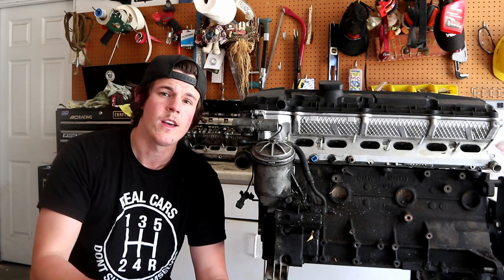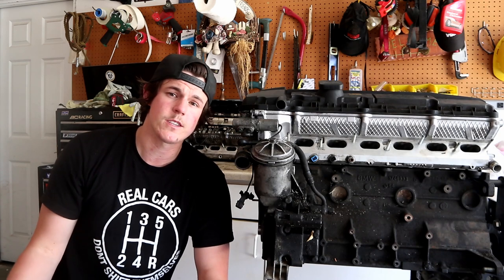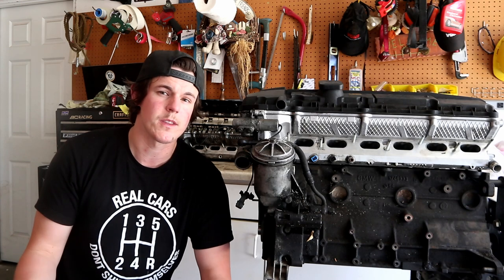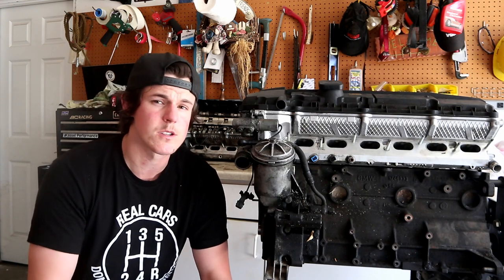So if you're leaking oil and it's either red or it smells like ATF, the transmission uses ATF. Some of them use heavyweight gear oil. So just note what kind of fluid is coming out, and if you don't know, ask someone who does. You can usually take a sample down to an auto shop, and one of the guys can tell you. Gear oil, especially used gear oil, has a very distinct smell, and so does ATF.